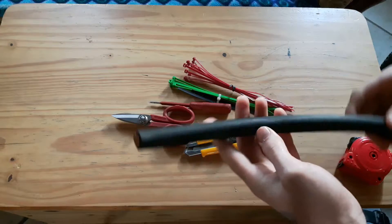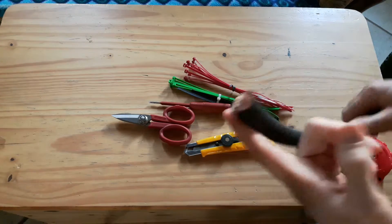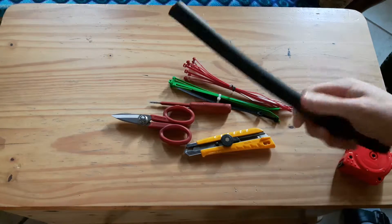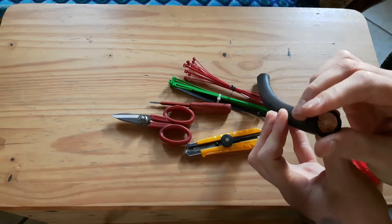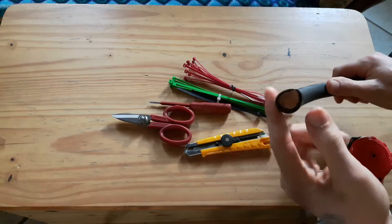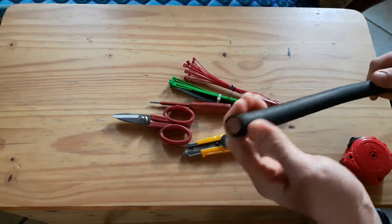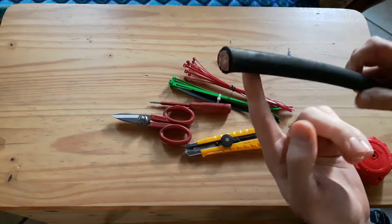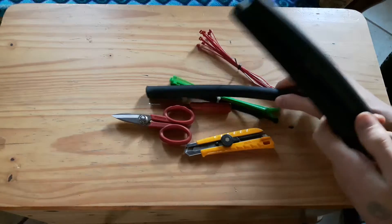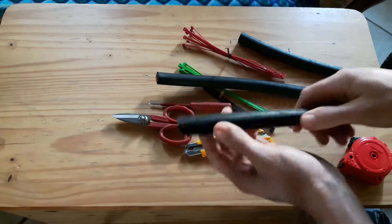I got these for free — they were just laying around at work, and that's where I got the idea. Electricians cutting off excess pieces left them behind. Inside there's a cable, but it doesn't matter if it has five wires or ten — all you need is the outer tubing. Try to find one that's rubber rather than plastic; rubber is much easier to work with and more resistant when the chain hits it. I've already cut and cleaned the tube, and it's ready to go.